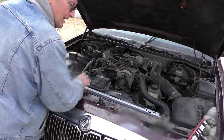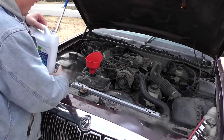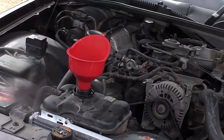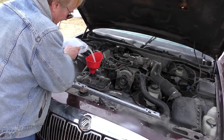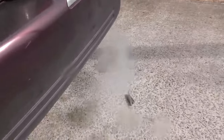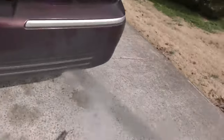Don't forget the other hose or you'll have a giant mess — there's the hose, goes right on there, put the clamp on nice and tight. Then tighten the bolts on the bottom back up. Now comes the easy part: fill it up with coolant — in this case it's the old Ford coolant, 50% coolant and 50% water. Start the vehicle up to warm it up. Unfortunately as it's warming up, a bunch of smoke is coming out of the exhaust. The car has no tags, so I'm guessing he drove it with a hole in the radiator and probably blew the head gasket.